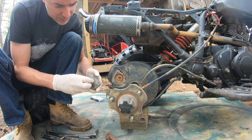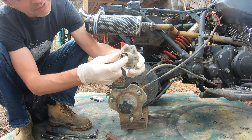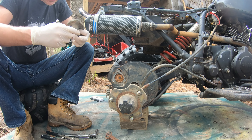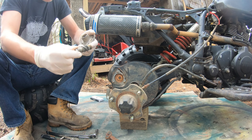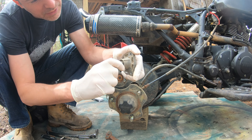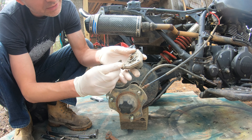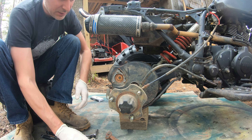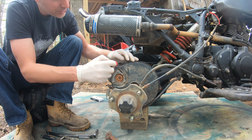This I'm going to want to pack with grease. You can see in here there's a kind of worm gear. This should all be packed with grease so things flow well. Then you've got this rubber seal, and this foot — which is what pushes the caliper. There's the caliper. Let's take this shield off.